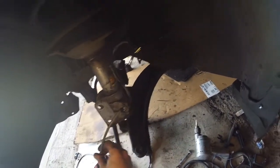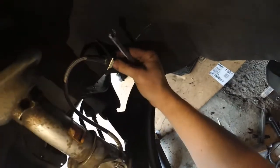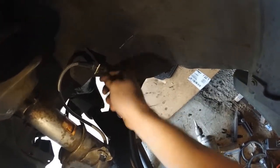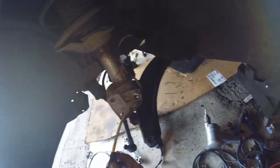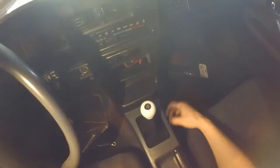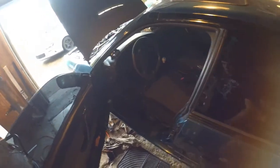I got my new brake lines installed up front — these are the StopTech braided brake lines. They weren't cheap. We had to disconnect them right here, and the hard line actually started to strip out so we tried to make our own tool by cutting the end out of a fitting, but it still wanted to strip, so I ended up using vice grips. It's a pretty simple install; we still have to do the rear. Inside here I got everything installed and ready to go. This interior piece is a different color because it's different from automatic to manual, so I got this one from the junkyard. I'm really excited about this eBay shift knob I got — it's pretty cheap but looks great.